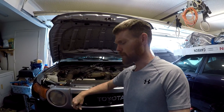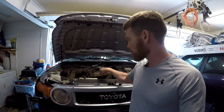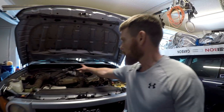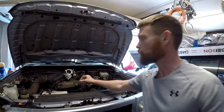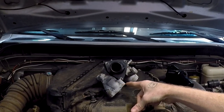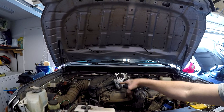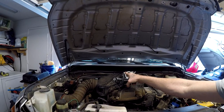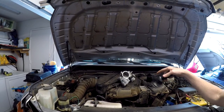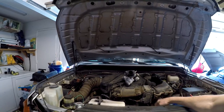That thermostat housing is specifically made for a Honda K20 or K24 engine — a very popular Honda engine capable of about 1,000 horsepower with appropriate mods. Because of that, people swap it into Nissans and all kinds of cars. I think it's even been swapped into a Lamborghini or Ferrari — someone did a YouTube build series on that. Because it's swapped into so many things, you need a thermostat housing with a swivel neck, which is the all-aluminum one I bought. I ground down the edges so it would fit the FJ Cruiser housing.